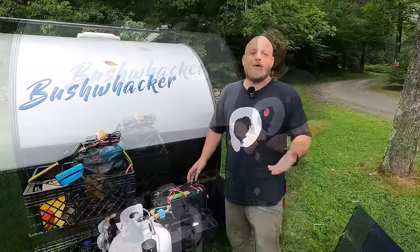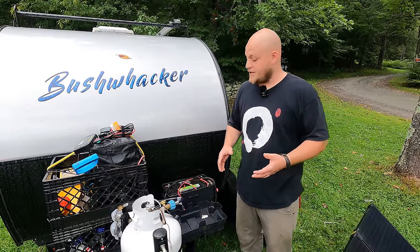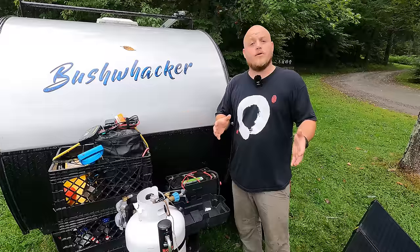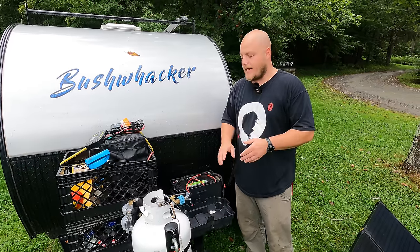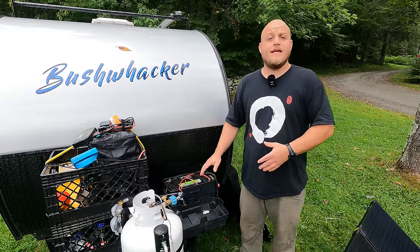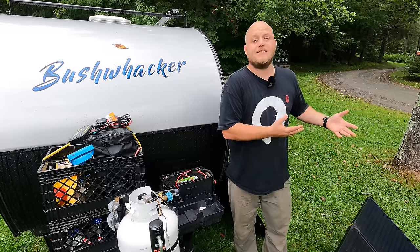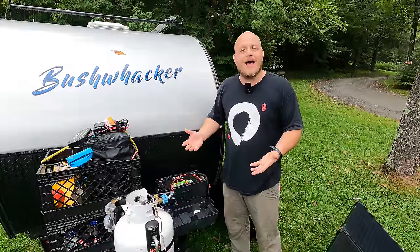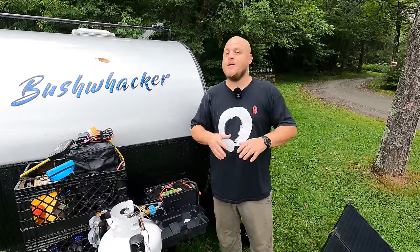Think of it like a rain barrel — if you have a small rain barrel and it's raining, by about 9 a.m. the barrel is going to start to overflow. That energy is wasted. It's the same with your battery. If your RV came with a 50 amp hour AGM or a car-type battery, you're not going to be able to store the energy you're creating from solar panels, so everything upstream of the battery is wasted. You're going to want to be able to go about three days unplugged with no solar without running your battery down to low voltage. If you can go Friday, Saturday, Sunday on just your battery, then once we go to solar we can handle a rainy day or a day without solar equipment out.